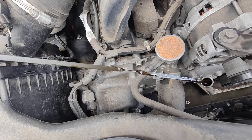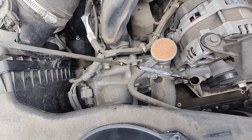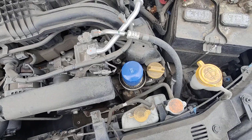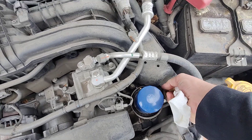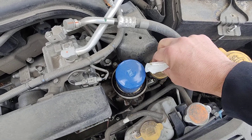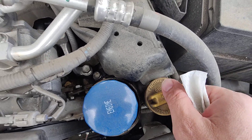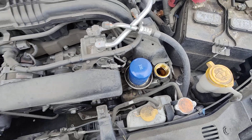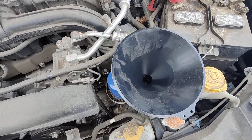Now as I'm checking this, I'm getting kind of a funny reading and I think it's just because there's too much oil kicked up. So I need to wait a few more minutes and let the oil settle back all the way down to get an accurate reading. I'll go ahead and do this section while we're waiting. We'll undo this — righty-tighty, lefty-loosey — this is the oil cap right here. Another nice thing is they put the grade of oil you should put in there. I personally like using a funnel just to make sure I don't splash it everywhere.